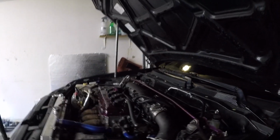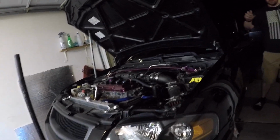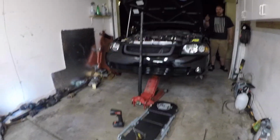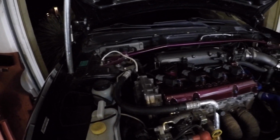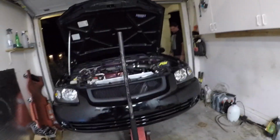Well, I thought we didn't want that. That's good. Regardless, you're going to have to get it to drive. Yeah. So basically, I just gotta undo the jam nut and twist it in. Dang, that would drive me nuts. That's straight, and your wheel's like... No. Like, well, doing this, it will be. Okay. Once I adjust the tie rod, it's good. Yeah, basically, I just need to adjust. It's bottomed out, so bringing it back out will re-straighten it. Dope. Basically, I had to bottom out the tie rod to make the wheel straight before. Okay. Hell yeah. So yeah, that literally takes like 4 minutes. Yeah, do your thing. Good old QR.